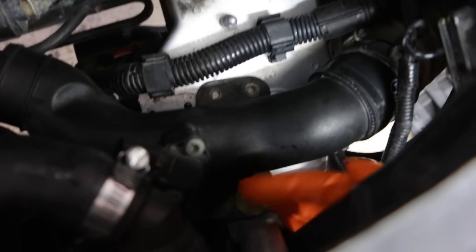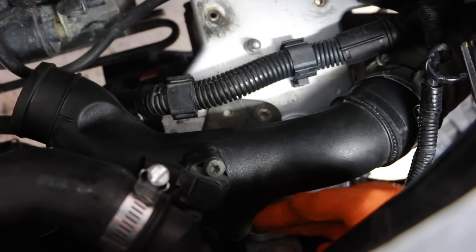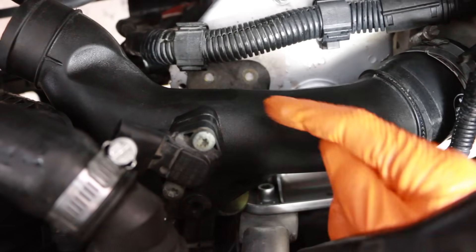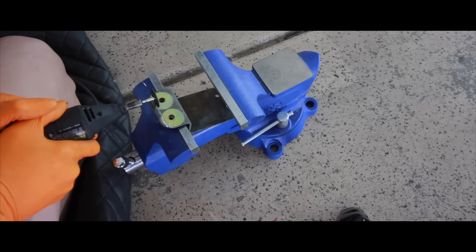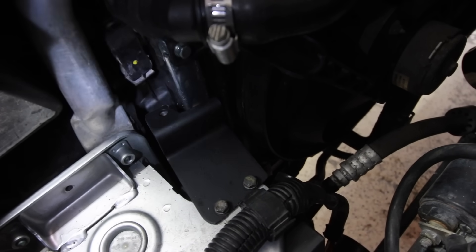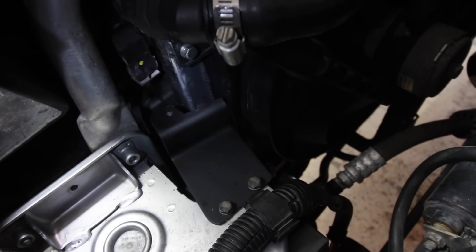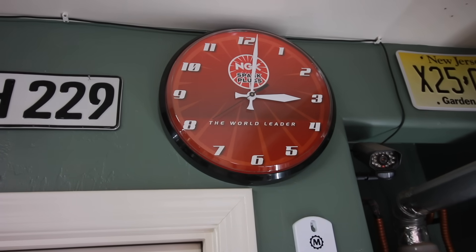I ran into a new problem because the upgraded radiator is fatter than the original unit because it's a dual core. This is the upper pipe for the intercooler — the driver side intercooler — and it connects right here to the intake manifold. This bracket is supposed to fit underneath of here and bolt in, but it can't because it's hitting the radiator. So I'm going to have to pull this bracket out and trim it down so it'll fit. Four hours later, I just stopped recording. I needed to make some progress, but check it out — I got the bracket painted, I shot some high heat paint real quick. I had to cut off an entire bolt hole so I could get it to clear the radiator, but it's on there. Now I can start putting the car back together. It's already three o'clock in the afternoon and I started at eight o'clock this morning, so I need to hurry my butt up.